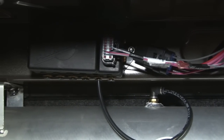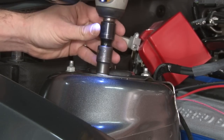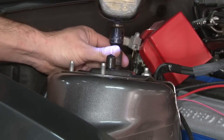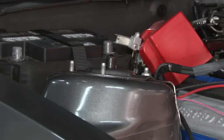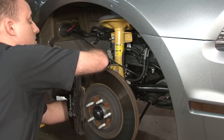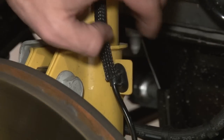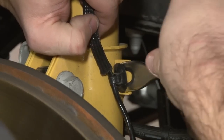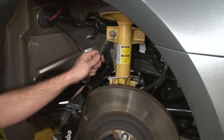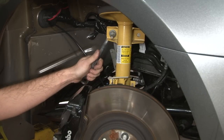The wires and hoses are done — time for the actual suspension parts. We're leaving one bolt attached so the strut doesn't fall while we work down here. Right now I'm removing the ABS wires so we can reinstall them once we get our new strut in. The front strut installation is just like installing a standard strut — there's nothing special, no extra holes or brackets. Direct replacement. You remove the sway bar end links, remove the two bolts that hold the strut to the spindle, then remove the top bolt and the strut comes right out.